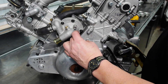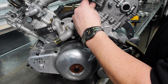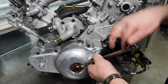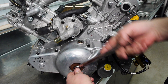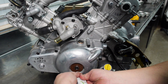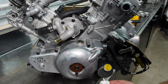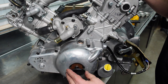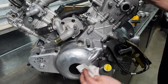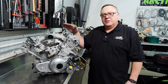Tighten securely. Now we can install our inspection plug. Remove our left-handed cap screw from the crankshaft, then take a little bit of black silicone and put a little dab here, here, and here. Reinstall our rubber plug and wipe clean. Now that's how you properly time the camshaft to the crankshaft on an H2 engine.